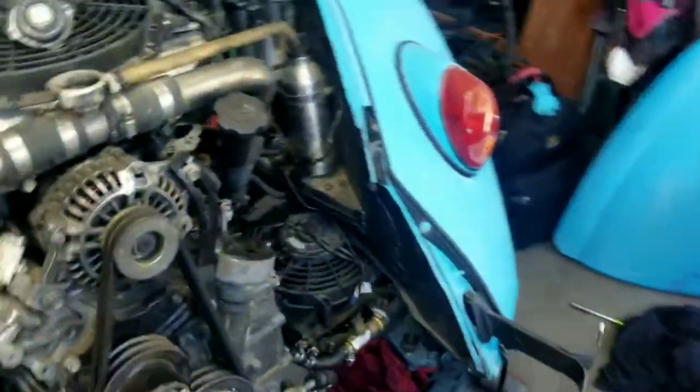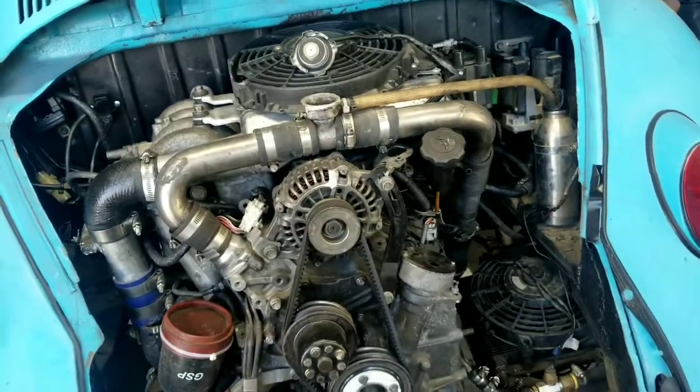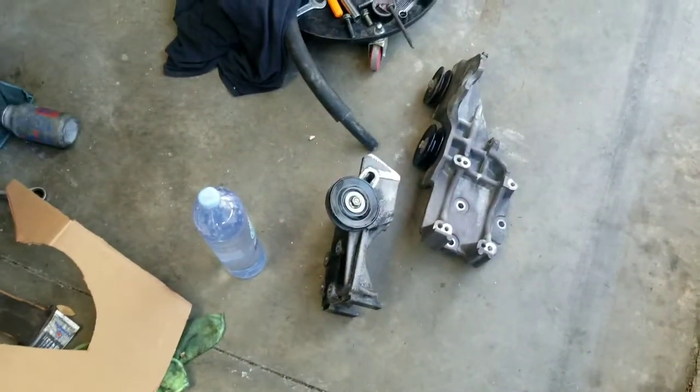So right now I think I'm just gonna put it together till I do some more research, but for the most part the cut down bracket will fit. So where was I? So the cut down bracket will fit, and then it's just a matter of figuring out how much hose I need. I think since I'm running a Series 6 radiator, I could get the Series 6 condenser, and that should bolt up. And that's yet another issue, because the electric fans I'm running, the motors are really big on them, because they flow 1670 CFMs a piece, so almost 1700 CFMs each.